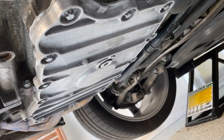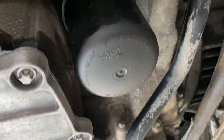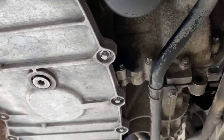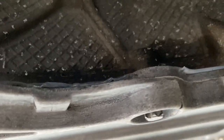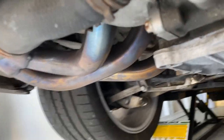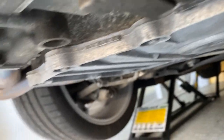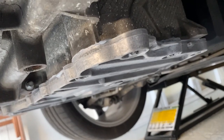I'm going to leave it running for about a minute or so then shut it down and take a fresh reading on the oil, because it's got to fill up the oil filter. By the time it's got all the way around I think I'll find it's pretty much bang on. I haven't quite run it up to operating temperature — the idle's dropped down — but I'm having a little look underneath for any sign of leaks. The sump cover so far looks all good. We've got nothing to indicate any issues, so I'm going to wait about half an hour to get a new oil reading.